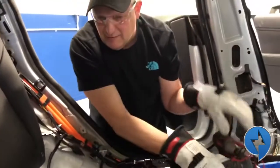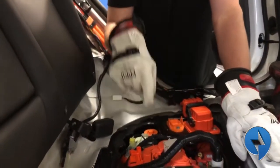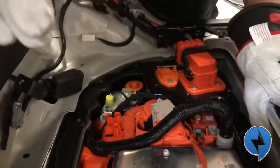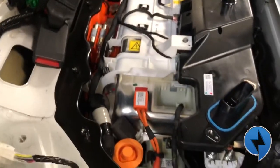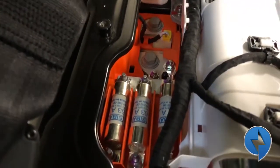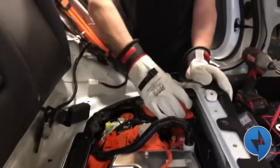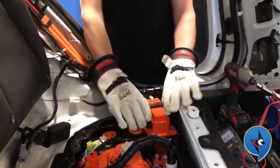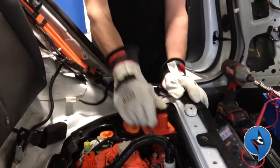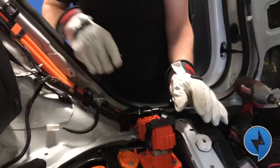I'm only getting one part of it because there are two contactors — one contactor here and another one at the end. That's power and ground. There are three main fuses for the circuit. Now I'm going to disconnect the high-voltage switch here — just pull this switch over, flip the lever, and disconnect. That's it. I'm going to do the two 10mm bolts on here as well.